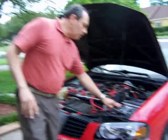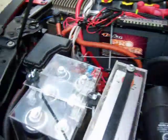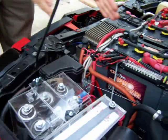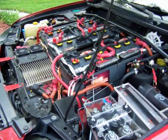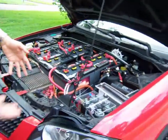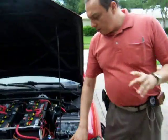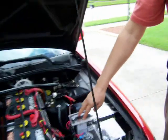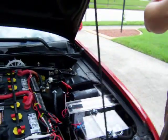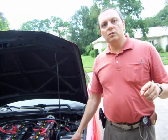Finally, I just want to note that capacitors are very good for electric cars because space is always valuable on an electric car, and these can be connected in any position — in line, in series of two — so in the future I can probably use the motor compartment space for something else and connect these under the car or somewhere in line. Since they're maintenance-free I can put them really anywhere in the car, saving space in the motor compartment. In my car these are really only being used for peaks. Most of the energy used by the wipers, the lights, and everything else is provided by the DC-to-DC converter.